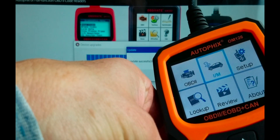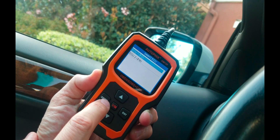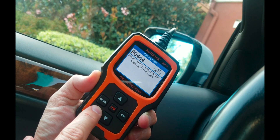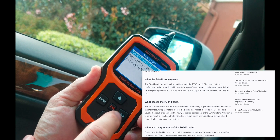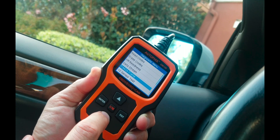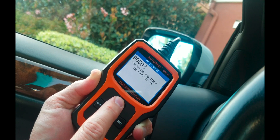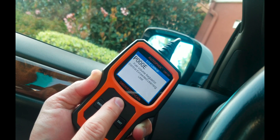So let's plug it in the car and see how it goes. I'm actually going to do a read and see what the actual error message was on the code. We'll go down here and select it — and there you go: P0444. If you look that up online, you'll see it's an EVAP system error message. It's right there in the device itself. You can even enter a specific code, scroll through and it lists out each one, or dial into a specific one you want.